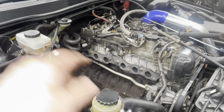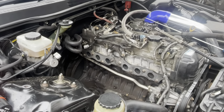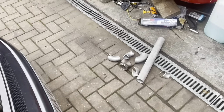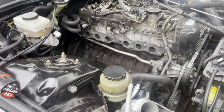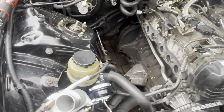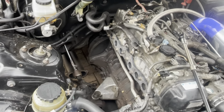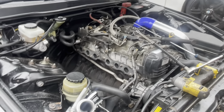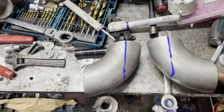First job: I've whipped off the exhaust manifold and now I'm just bolting up a mild steel flange I bought. I felt mild steel was maybe a bit easier to deal with if it warped — slightly less susceptible to warping than stainless. I've got that and heaps of tubing. I'll position the turbo where I'd like it and work from there, making our own sort of log manifold and going three inch down to the mid pipe. This part is probably going to take the longest.